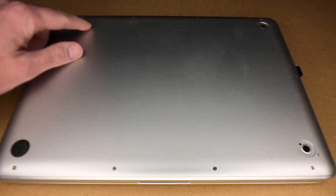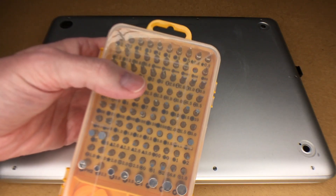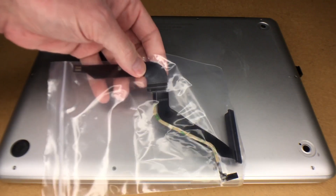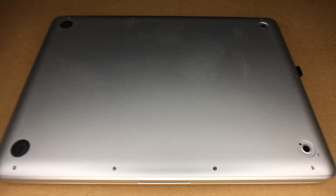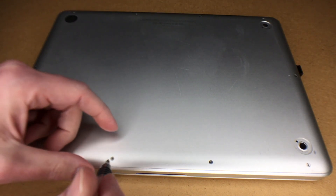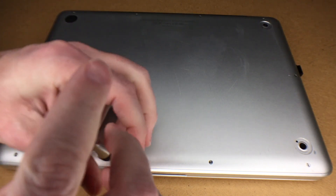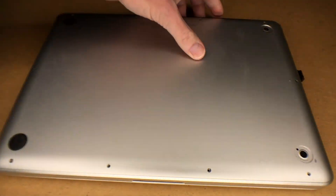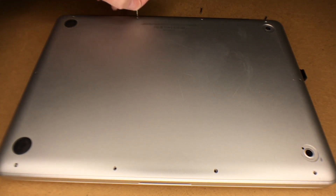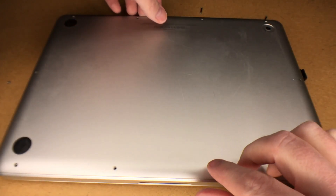We have Phillips screws around the perimeter — they're double-aught, and I'm using this Apsong tool kit. I'll put a link in the description to this, and also a link to the cable I'm using. If you find this video helpful and use that link, it helps me out a little bit — doesn't cost you anything extra. I'll take out all these screws and set each screw next to the laptop so I know which position they go in, because the screws can be different sizes. Now that I have all the screws out, I'll lift the back off.